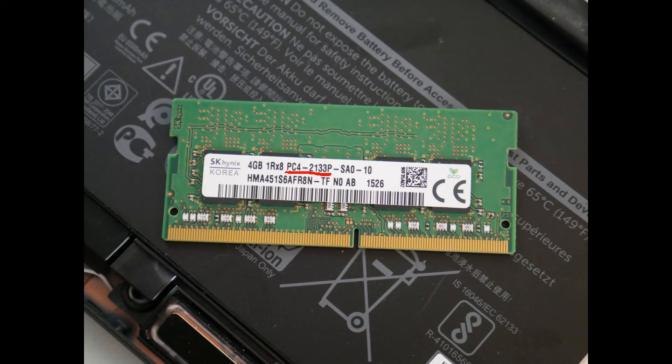It would be a code similar to this. If you only have one RAM stick, you may need to buy a new one and try swapping it out to see if that works. If you don't have the option of taking one out, don't forget you can always upgrade to more gigabytes of RAM, which is never a bad thing. That is how I would diagnose this problem.